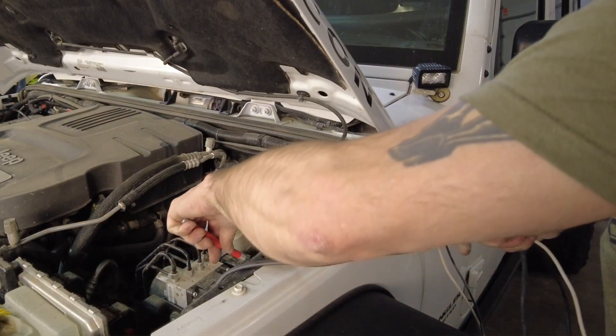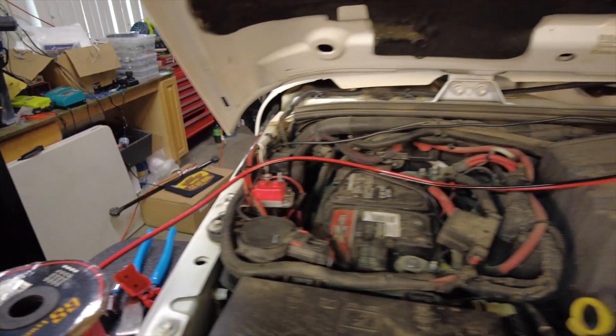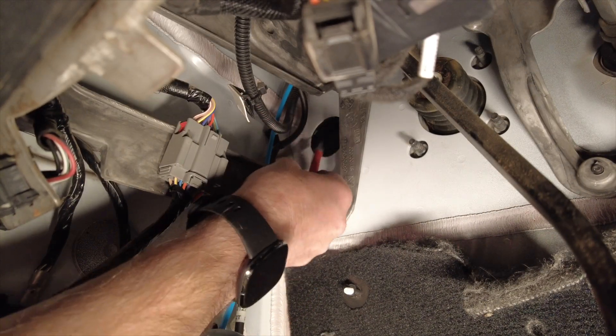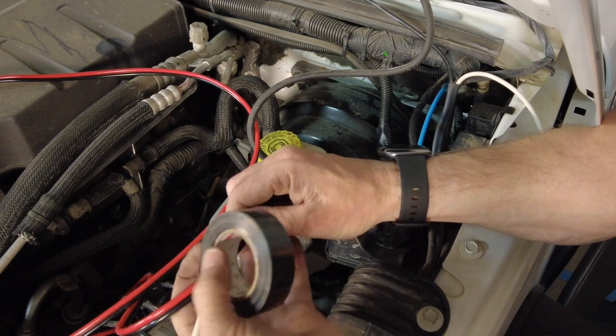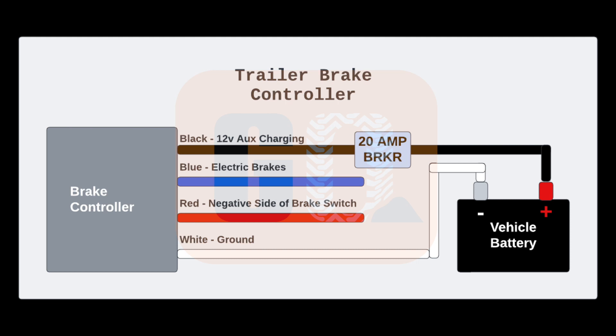I stripped the sheath to separate the wires. Next I'm going to run a pair of wires from the battery to the driver's side of the Jeep for the power for the trailer brake controller. There's a grommet in the firewall just here. I pushed a coat hanger through it and then taped the wires to the coat hanger and pulled them through. Now it's time to wire up the brake controller. We've got four wires to connect. The blue wire connects to our white wire that runs back to the trailer plug. The white wire connects to ground on the battery. The black wire goes to the circuit breaker and then to the battery. And the red wire connects to the cold side of the brake switch for the brake pedal.